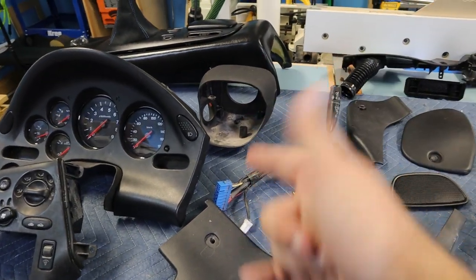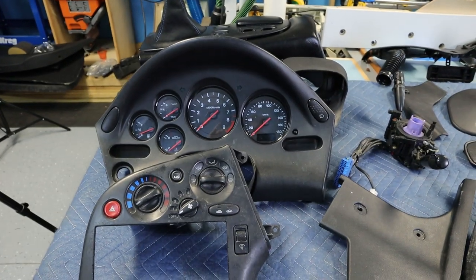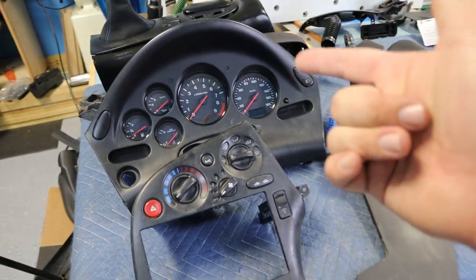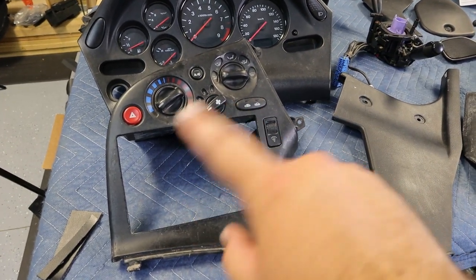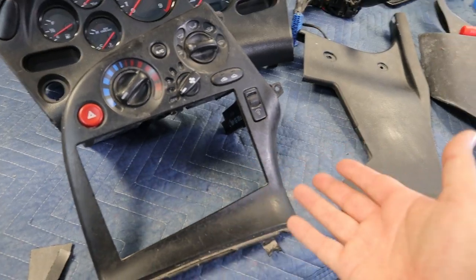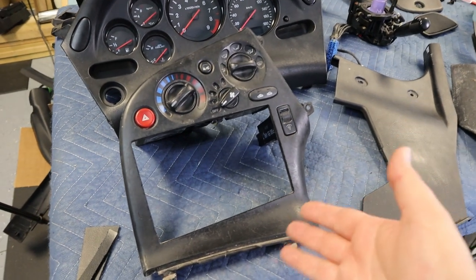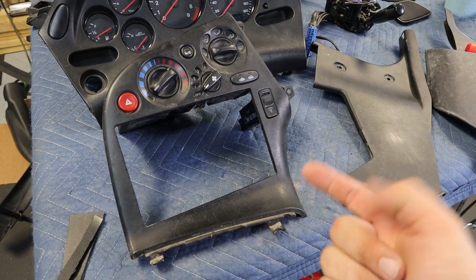The center console and some of that trim is all ready to go back in the car — I'm just waiting until some other stuff goes in first. I've got kick panels, a center dash speaker grille, the clamshell for the steering column, and the cluster. I'm really not going to do a whole lot with the cluster other than maybe fix the lighter and replace some lights — I'll do any mods to it later so I don't introduce new problems. The biggest thing I've got left is the bezel that goes around the head unit with all the HVAC controls, which I'll deal with in the next video.